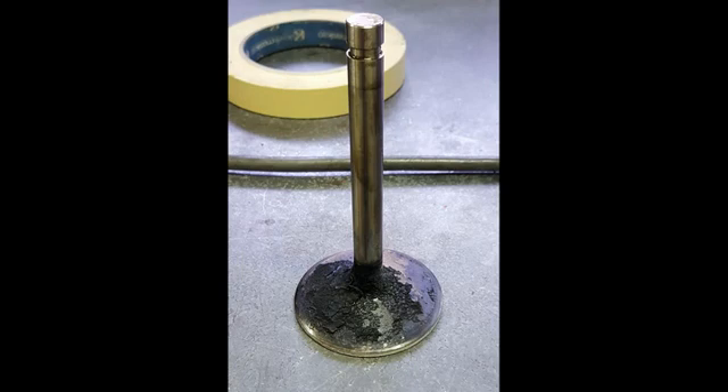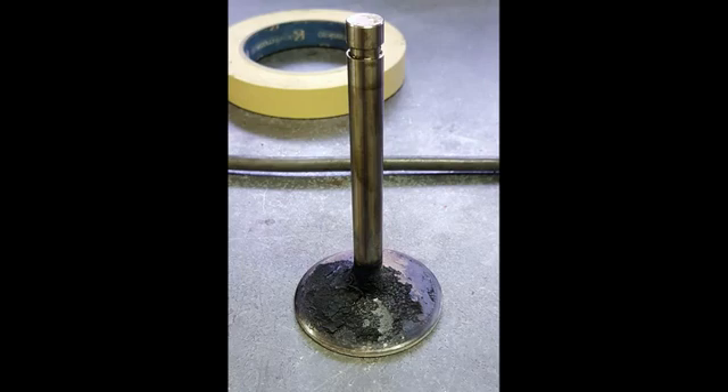The problem was the intake valve wasn't sitting properly in the cylinder, hence the carbon deposit on the base. Lou the engineer said that it was running a little bit lean, but not enough to be a problem. In our next picture you'll see that the left valve is the exhaust valve — it's a lot cleaner and was sitting properly. You can see the contrast to the intake valve on the right, which was the problem and wasn't sitting properly in the cylinder.